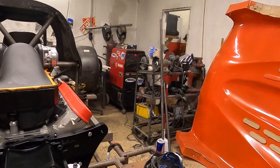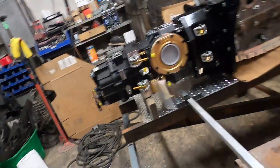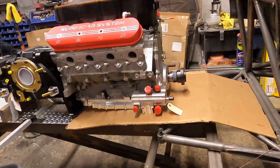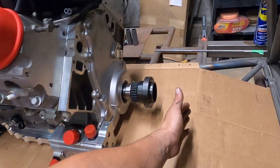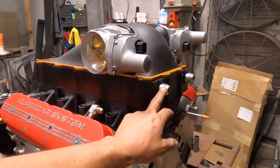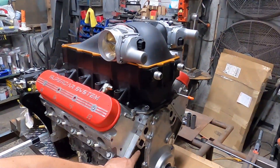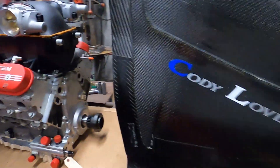Wait till we try to mock up two of them - oh god. Everything's pretty good. We need to do fine measurement checks, but it's sitting pretty good right there. It seems like there's about 17 inches here roughly, with it sitting on the end of the crank. Fuel cell is 12 inches on the bottom, so there's plenty of room. The water-to-air intercooler is super awesome - billet blocks with twin feeds on the front.